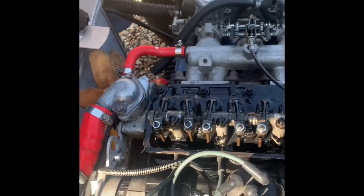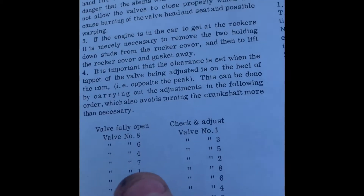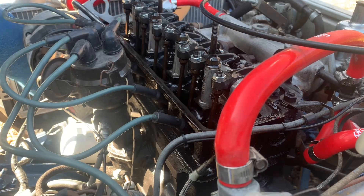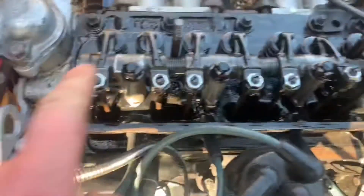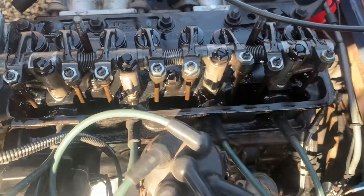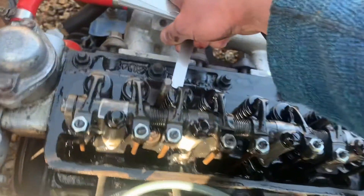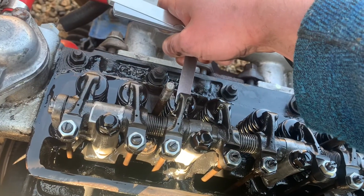So now I'm going to go to the manual. This picture was the one I told you to screenshot. Number eight fully open, number one. So now I'm going to go to six, which should mean that three is the one we're going to be adjusting now. Four, five, six should be fully down. So I'm going to get the feeler gauge again — and this one also feels like it has a little bit of resistance.